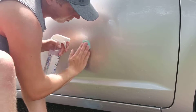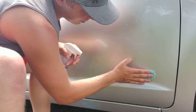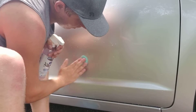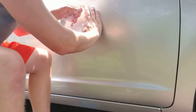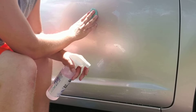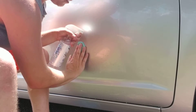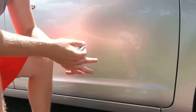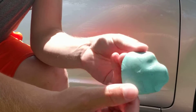What this is removing is all those contaminants on the vehicle. It's an ultra fine clay bar so it's not removing everything, but it's removing about 90% of the contamination. I can take my nail and just catch on whatever it is — I believe it's tar — and because of the lubrication I'm not scratching it. Believe it or not, you can actually clay bar a vehicle with a utility blade using the lubricant instead of an actual clay bar — not something I've tried. I just did about a quarter section of the door here.